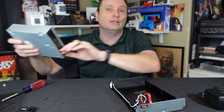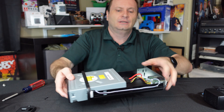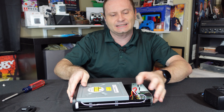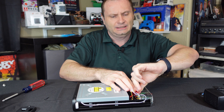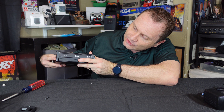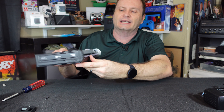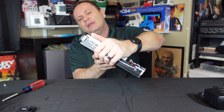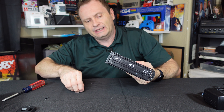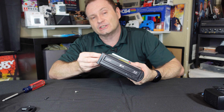This is remarkably easy — you certainly don't need any instructions as long as you have some general idea of how this stuff works. Slide the unit into the front. Before you put it all the way in, connect these two connectors right here, make sure they're nice and firm. Then just slide it on in and put the cable down a little bit to make it comfortable for the top to go on. You can align it so that it fits nice and flush, or however you'd like — the slots on the side can accommodate some adjustment, and the screw holes allow a little bit of flexibility.